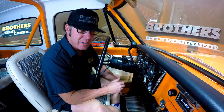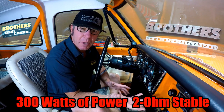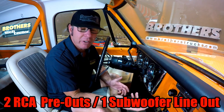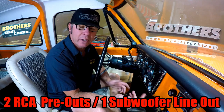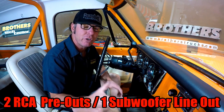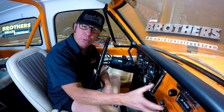Some of the other features of this radio: it's expandable. It's got lots of power if you just want to use it right out of the box like I am with a couple of speakers, or it's got RCA output so you can run extra amplifiers. It's got a subwoofer output so you can run an amplifier straight to a sub. It's got a built-in crossover network so you can adjust the sound of your crossover as well as your separate speakers through your RCAs.